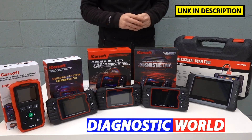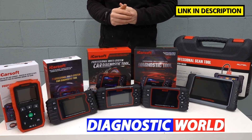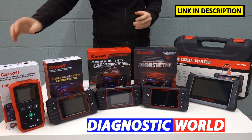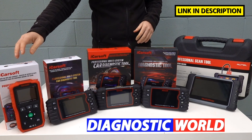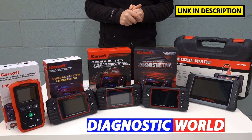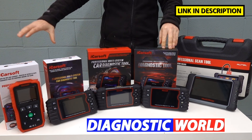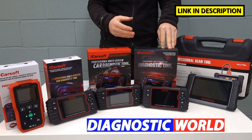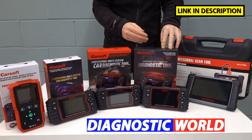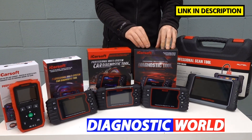It all really depends on your specific needs and requirements. If you only have something like a 986, 987, 996, or 997 and you just want to do an airbag reset or an ABS/PSM diagnose and reset, then there's no problem going for the POR Version 1.0 — it'll do the reset just as well as the top tool. Which of these tools would I personally go out and buy? It would be the CR Pro kit, because you get all of the functionality, all of the system coverage, all of the manufacturer coverage, and the special functions as well — the best value for money tool.